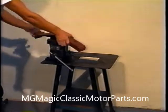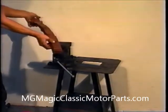Here we have our properly modified spring. The rubber insulator has been removed and we have inspected the front bushing. When we find worn or deteriorating parts, we replace them with new parts available from our local auto supply store or Ford parts department.